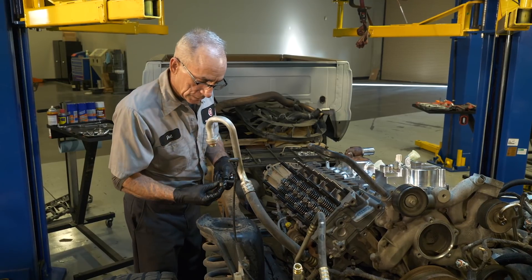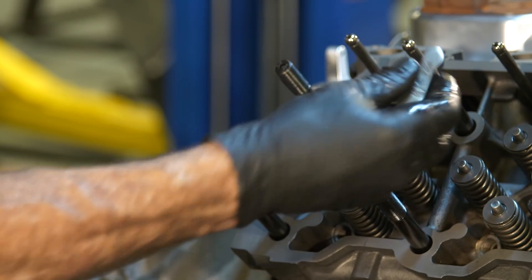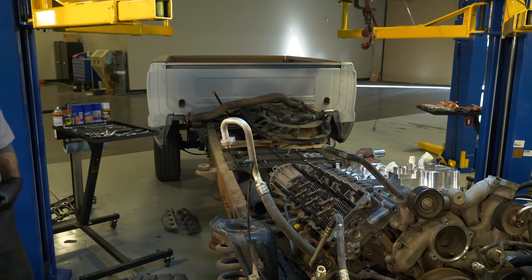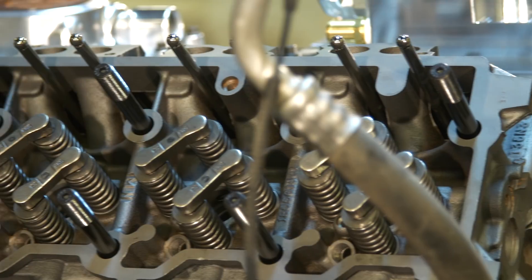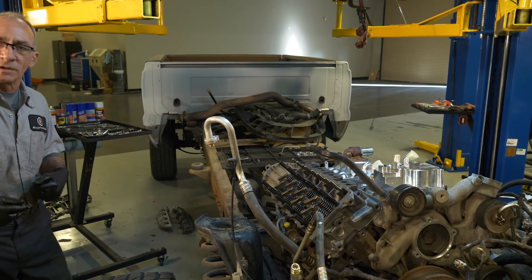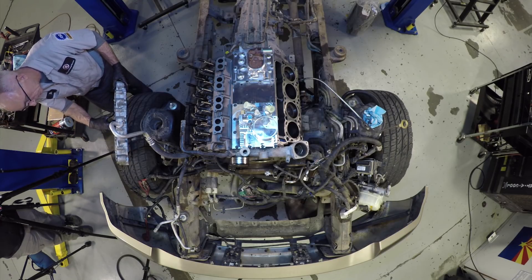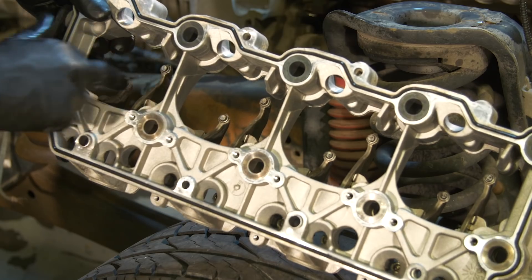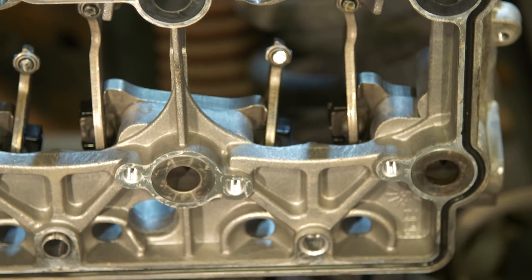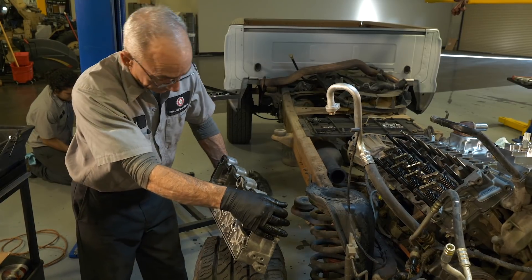Bridges are next. They have an oblong side — I always put the oblong side up. Next is the rocker carrier. A lot of people take the rocker carriers completely apart, each rocker, but you can remove it as a whole assembly and it's much easier if you do. It's a good idea to inspect the tips — they have been known to come off. There's a little pivot on the ends and also a little ball that sits on the pivot. Those can also come out, so just make sure they're there. It's really bad when they're not — it'll take the head right out.